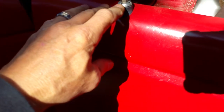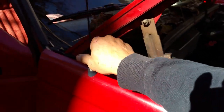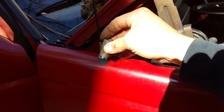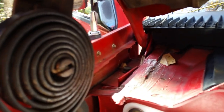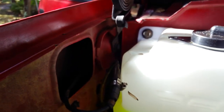I was also considering getting a new antenna. To remove it, you have to have this special little tool right here. Once you take the antenna off, you use this tool with a basic wrench to loosen this nut right here. Then there are two screws behind here that have to be removed, and then you can feed the base of the antenna through this big hole here. So if you did want to replace it, you could fairly easily.